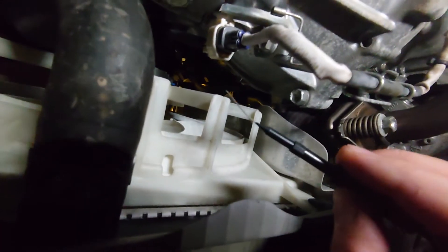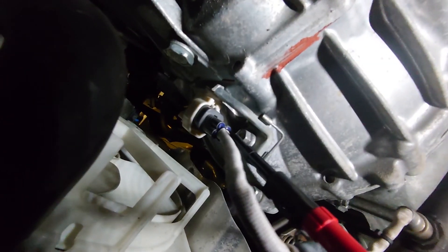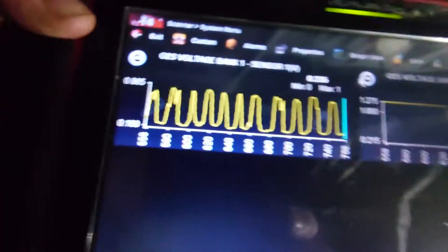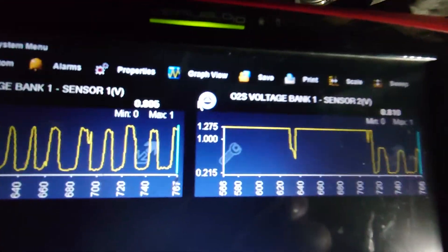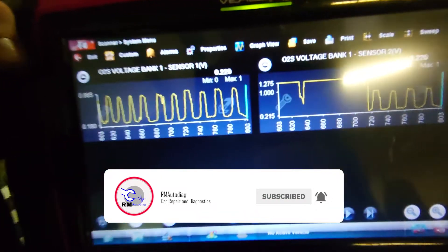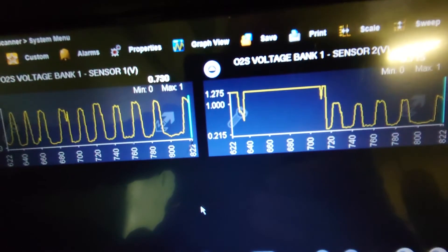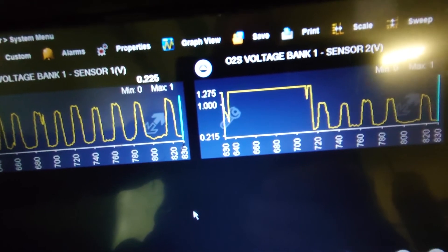So I've got the other end of the jumper wire, and we've got the black wire here — this back probe down here. We've got our response back. It's just come out one underneath the car. I've got my response back here. So that proves that the wiring works, that proves that the ECU is responding.